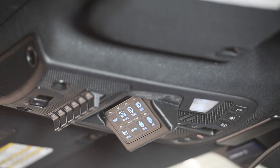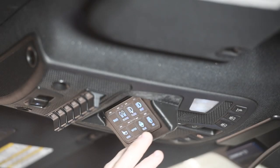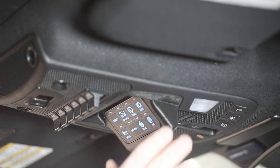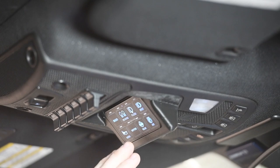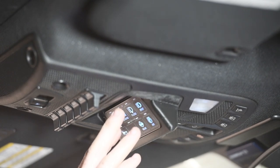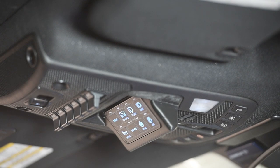Today I'm going to be showing the Switch Pros SP9100 that I have mounted in a custom mount that I made and I'm selling on swarfworks.com along with the SP9100s. This eight-output switch panel has a remote module that mounts under the hood, connects to your battery, and supplies four outputs at 20 amps apiece and four outputs up to 35 amps apiece.